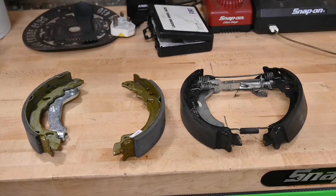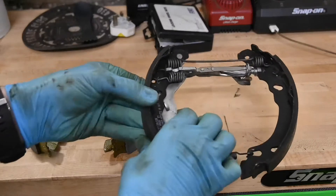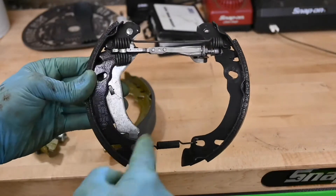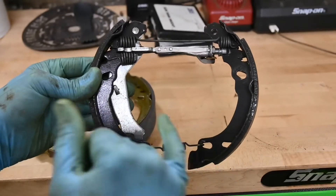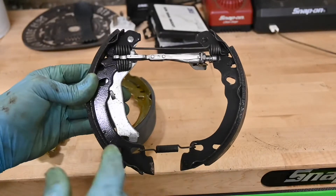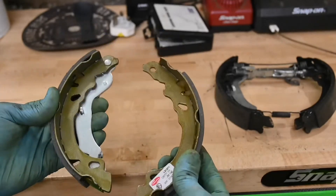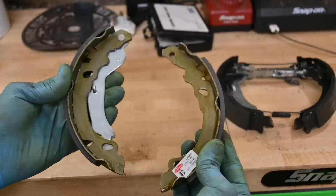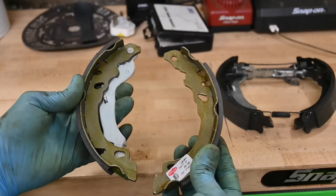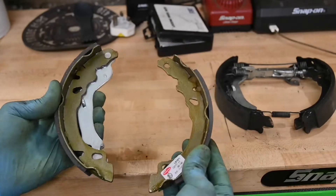Off screen I have already fabricated the pipes for the rear brakes, and because I'm connecting them up to the wheel cylinders, I've already installed the new wheel cylinders. The next step is to replace the brake shoes. This is from the good side - we've got the two shoes here which open up and put pressure on the inside of the drum, with retaining springs and adjusters to keep everything in place. You literally want to take all these springs apart and transfer them over to the new shoes. Before replacing any components, make sure you marry them up to the old ones to confirm they are the correct parts, otherwise you could have a car on the ramp disabled.